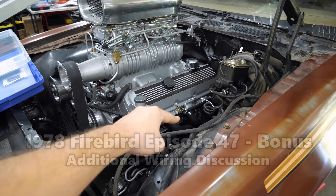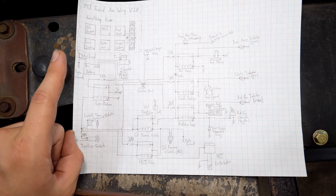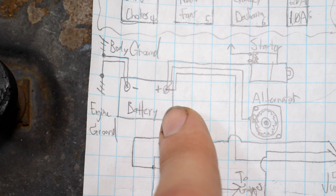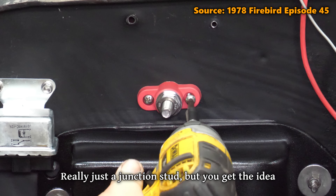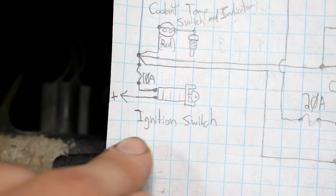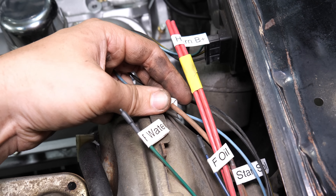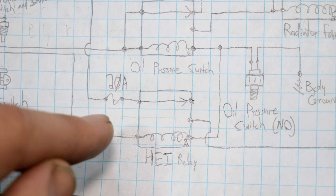This is the kind of complicated under-hood stuff. I don't think this is very interesting, so we're not going to spend too much time on it, but I do want to show one thing. The way we're going to set this up, the positive battery post will be coming directly to a junction block — that's what most things are going to be connected to. I'm going to do a few things I haven't done before, the first of which is using the ignition switch feed that used to go to the HEI distributor to power a pair of relays, one of which is for the HEI itself.